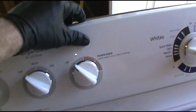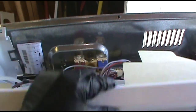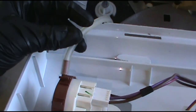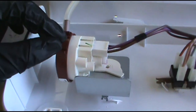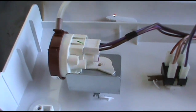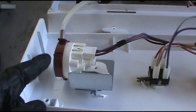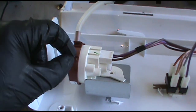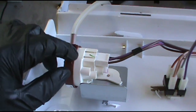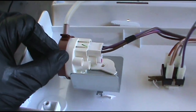I got the three screws out of the back and this panel should just slide over and pop up. And there's your pressure switch right there — there's the hose you were blowing in that you pulled off the tub. It's pretty much just plug and play. Blowing in the hose will get you out of a pinch, but it usually means this is going bad if it's not clogged. Now if it was clogged, that was the problem. But if it's not clogged, it usually means your pressure switch is on its last leg and you'll need to replace it, but it'll get you through for the time being.